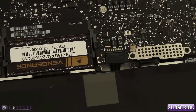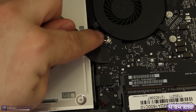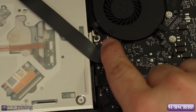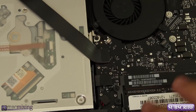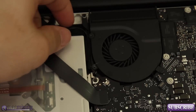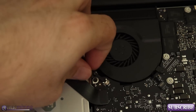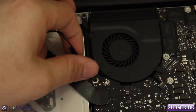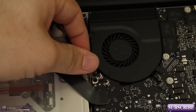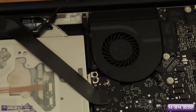We're going to go ahead and remove a few other cables. The next on the list is this little camera connector cable right here — it's very tiny and looks very fragile, so don't pull too hard or you will break your MacBook. This little wire actually wraps around the edge of the CD drive and there's some tape here holding it down. Just take it and slowly pull it parallel with the logic board — don't pull up on it, just pull it parallel — and it pops out just like that.